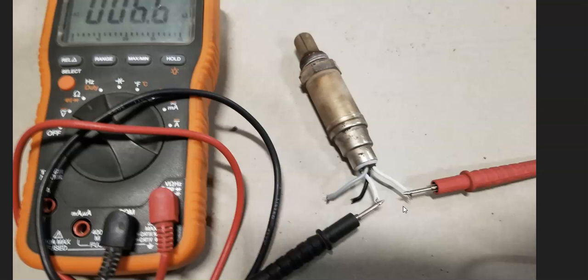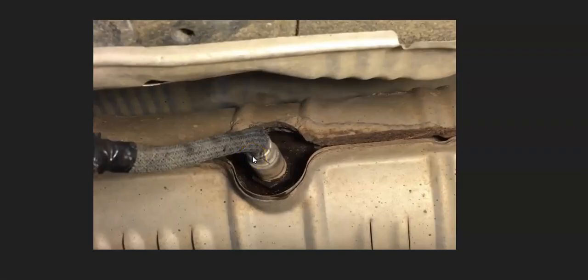It's kind of like a light bulb — if it blows out, then it's bad. There are some good YouTube videos on how you go about testing these, and testing the heater element side is fairly simple. The next step is to go around and test the O2 sensors to see if any of them fail, or replace them.